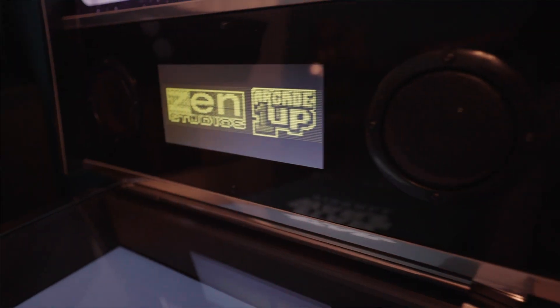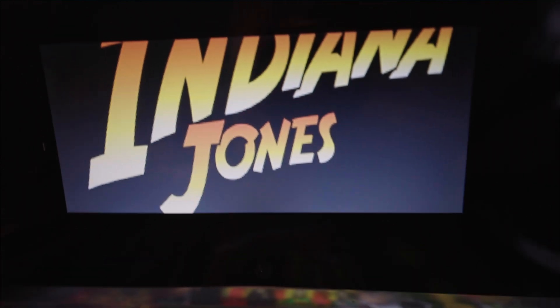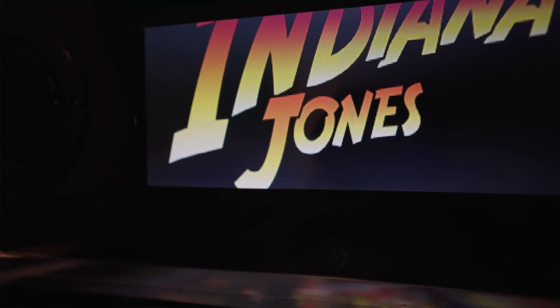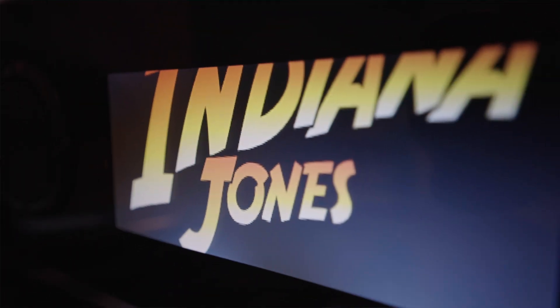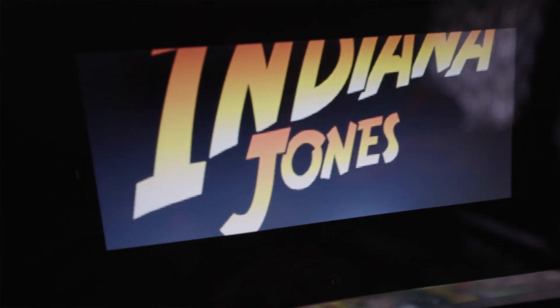This mod really only applies to people that have modded their arcade one-up pinball machines. Technically you can do it on a stock machine, but you're not going to get any advantages because the fixed aspect ratio of the scoreboard on the DMD screen — thanks to the PCB settings — won't allow you to stretch your score and utilize the extra space we're going to gain.